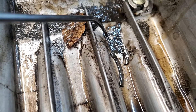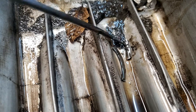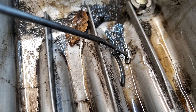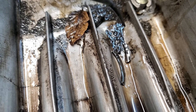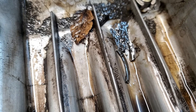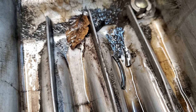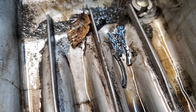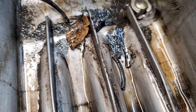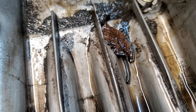I think because of the bike's age and because we know somebody's been in here before, the previous mechanic may have pulled the top end off, switched out whatever needed doing, put it back together, and didn't bother checking the lower end — which is what we're looking at here. Your engine really does run nice, so relax your shoulders, lower your eyebrows, breathe — this is okay. I'm going to get in there, clean off the pickup screen, and make sure it's nice for future oil changes. Perfectly intact. There it is, my friend.